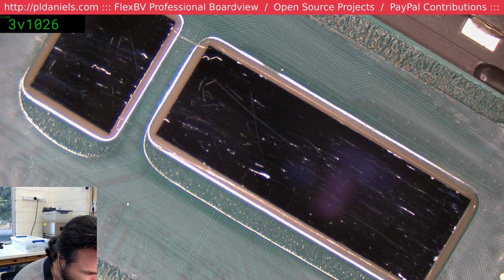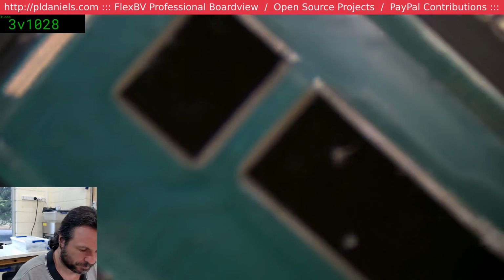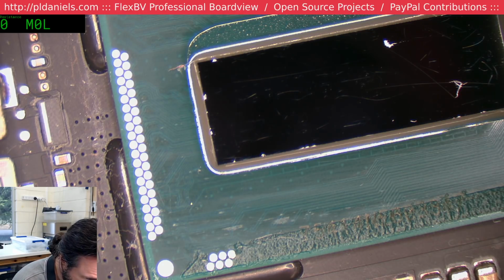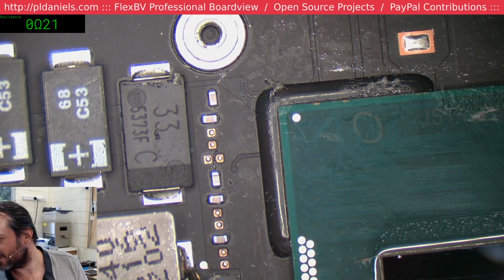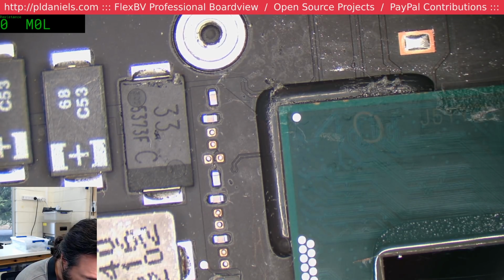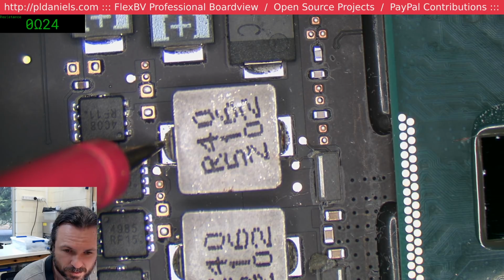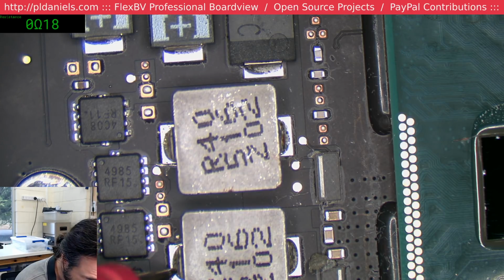Alrighty, let's get in where we want. Let's see what our CPU resistance is anyway, since we're here. Could be a very short drop to nothing just now. 0.2 ohms. Oh shoot. Come on, don't be like that. I think we're dead CPU. 0.23. 0.23. That's not good.